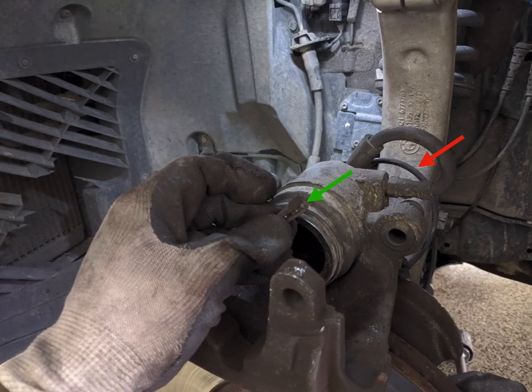The last thing I wanted to mention is that on the driver's side there is the brake wear detector — that's where the green arrow is pointing — and the cable for that is where the red arrow is pointing. That's the only difference between the two sides. The new brake pad for the inside will have a little slot, and right where that green arrow is pointing, the detector will just slide into that slot. It'll then detect when the brake pads are next down to the point where they need to be changed.